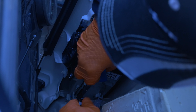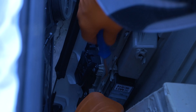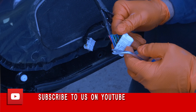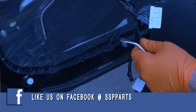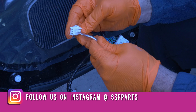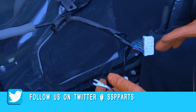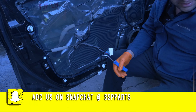There's one more down here and one more down at the very bottom. Push this down — it unlocks it. Push down here and it locks it safe. Three plugs total. That's how you remove the door panel.